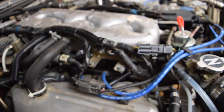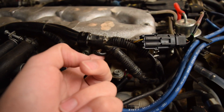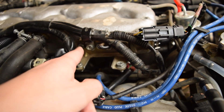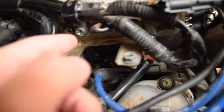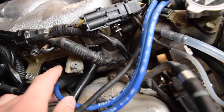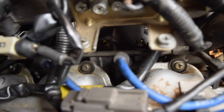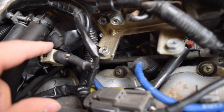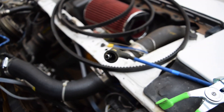On this side of the engine — the passenger side for the US — you have a little bracket. If you have the injector cooling fan you have the bracket, otherwise you may not. There's a ground here to be careful of and an injector clip. There are two bolts that hold that bracket in, and you may need to remove it to get the spark plug out, but just to get the boot you don't need to. Pull it straight up — you want to pull on the boot itself, not the wire. For this one you might also need to remove the PCV hose.